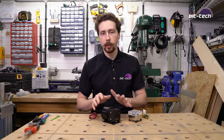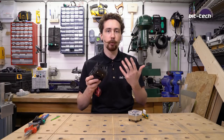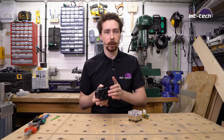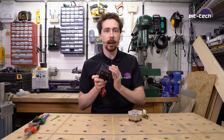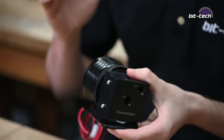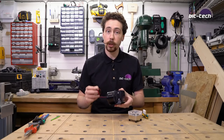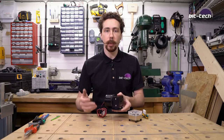We're going to start with the D5, mostly because this is the pump I tend to recommend. They're very beefy — you're going to need a really big system to outdo a D5, they're going to supply all your needs for the most part. They're also very quiet; when you set them down to about 40% you basically can't hear it. They're also very easy to plumb in, they're just a bit big.